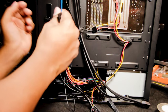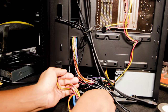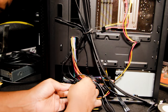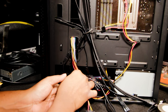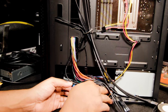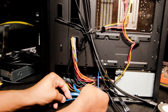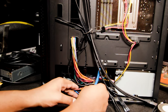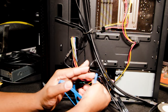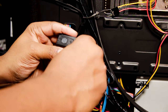She's mounted. Plug in our SATA data cable — that's connected. Plug in the hard drive power. Now we've got power and a data cable for the hard drive. The computer case has a little cable entry here; we can pull the cable up through and connect it. The rest of this cable we can move off, but we need to route behind it to connect the next cables.